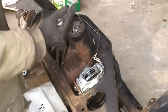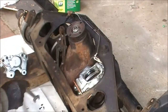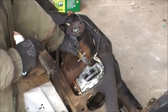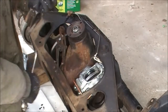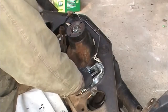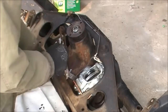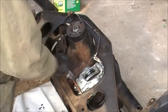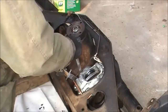This is for this side. I've got it on loosely. It's a 5/8 bolt that fixes — there are two of those which had the wires on them. It is impossible to get your hand into the gaps to hold the bolt in place, so what you have to do is use something thin like a knife, line it up with the bolt hole, and push it on the end of the bolt.